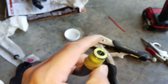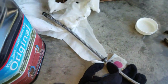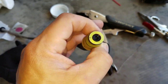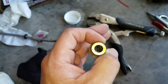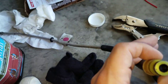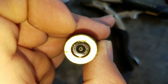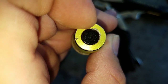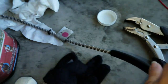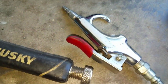What I'm going to do now is take an air tool and jam it down in there and blow out all the shavings from the end of the hose from when you drill it. Of course there'll be shavings — little pieces of metal — and you don't want that flowing through your slave cylinder inside your transmission. That piece on the end of this hose connects into the slave cylinder. You can push it down using a tool and then pour brake fluid in there and let the shavings flow out, or just use compressed air to blow through.